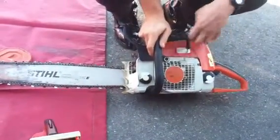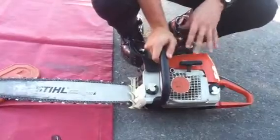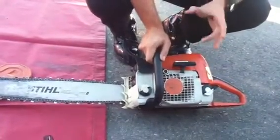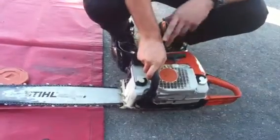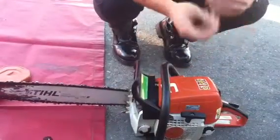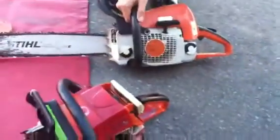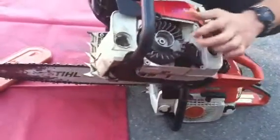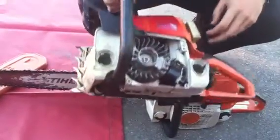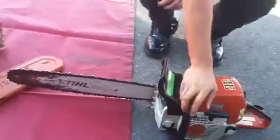Right here is your starter grip, flywheel, and flywheel cover — you may also hear the term starter handle, so make sure you know both. What the flywheel does is it sends an electrical charge to the spark plug, which in return creates combustion in the cylinder. There's a stationary and a moving magneto — that creates the electrical charge which gets sent to the spark plug to create combustion. Another function of the flywheel is to cool the engine; it's a primary mechanism for cooling.